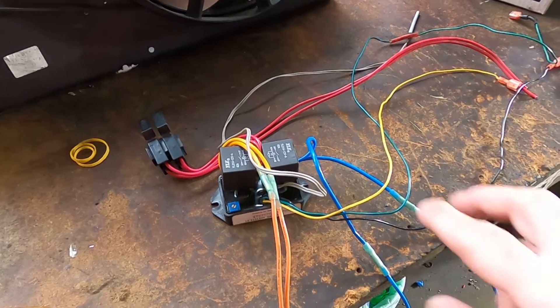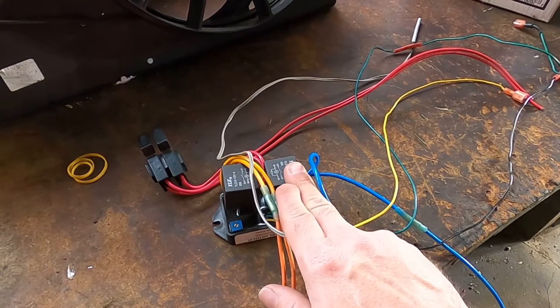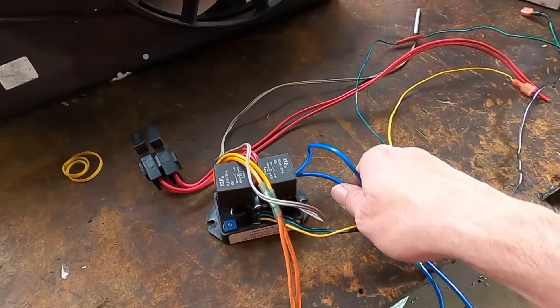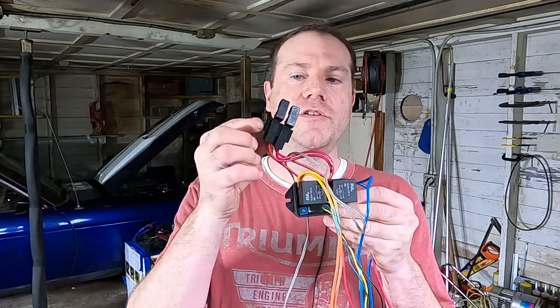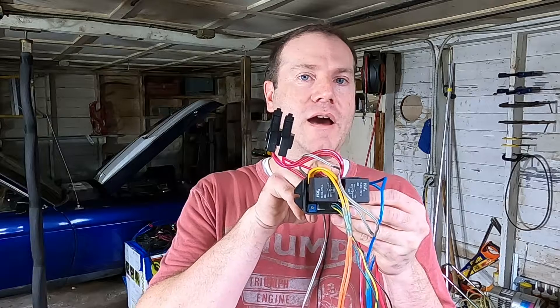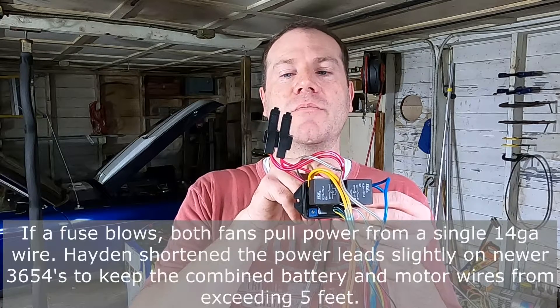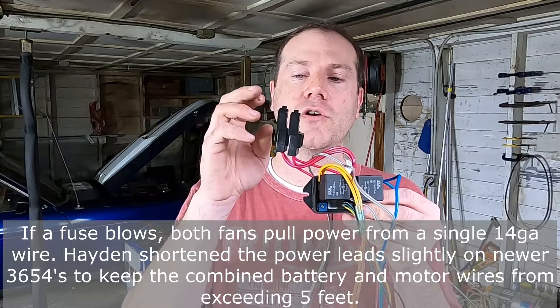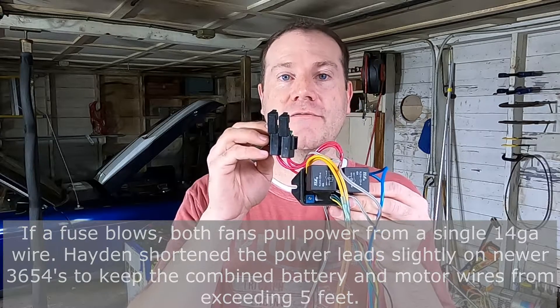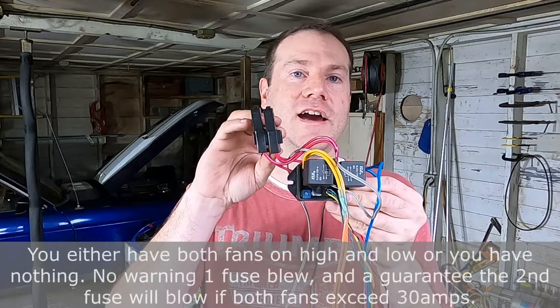The relays on the Hayden are low speed and high speed — this is the low speed relay and this is the high speed relay, which is kind of opposite of what you'd expect based on the wires, but that's what I found in my testing. There's less redundancy than you think. The two fuses are both 30-amp fuses running from the battery to the fuse block into the relay power for fan power, but neither one is isolated. So if you lose a fuse, nothing changes — you still have low speed, high speed, fan one, and fan two. If you lose both fuses, you've got nothing at all.